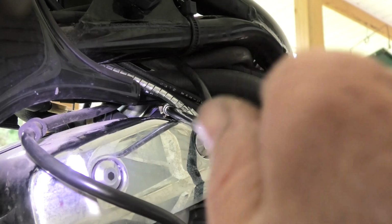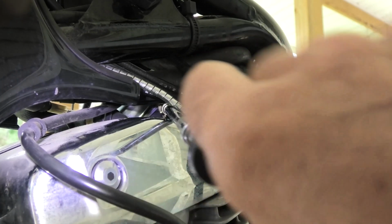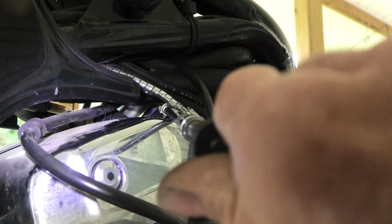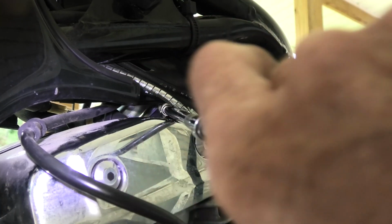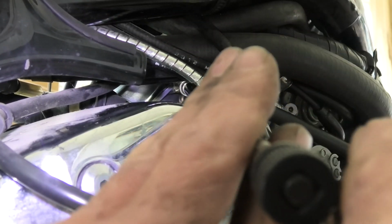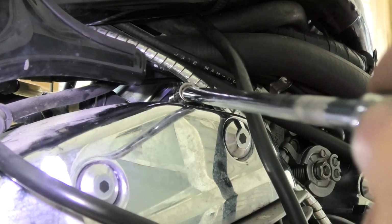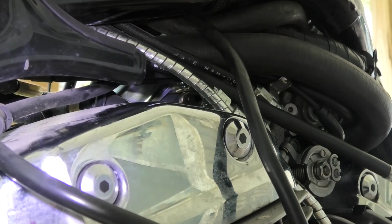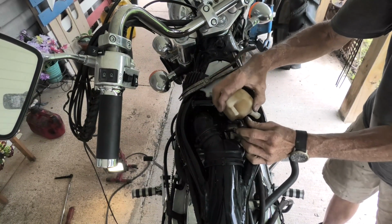And tightening this next one, I'm going to use an extension here, about a foot long. Again, a little ratcheting tool there, and turn it in until I get it started, and then we'll just crank it tight with that little ratcheting tool. And if you look when I pulled the extension out, it's actually a wobble extension. It gives the socket a little room to wobble back and forth to work into a tight place.